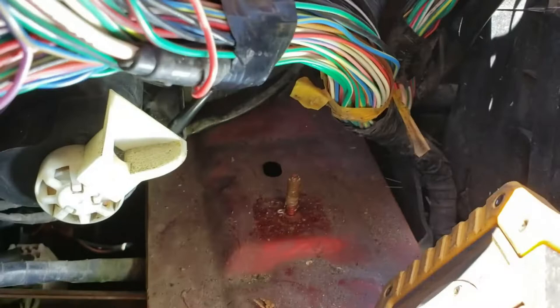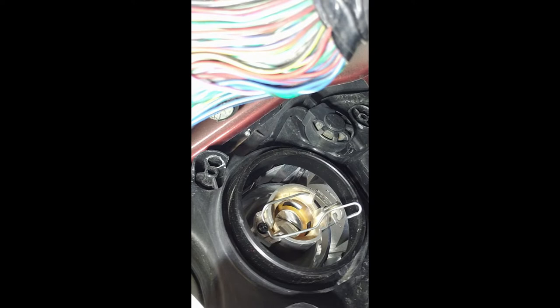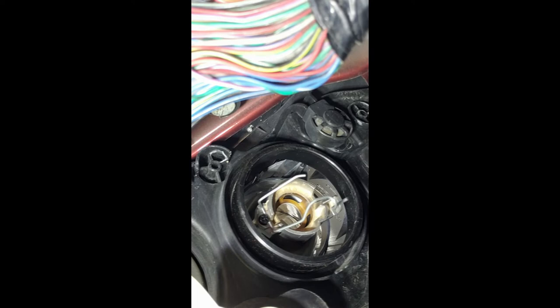Okay, so there is the spring clip. It hooks under a plastic tab. When you're taking the bulb out, you push the clip towards the front of the car and kind of tip it to the left and it unhooks and swings out of the way, allowing you to remove the bulb. Now you can see the bulb in place and that spring clip underneath the silver plastic tab — that's the part you release and the bulb just pops out. The bulb is oriented — it has on its base a black plastic tab which fits into the appropriate slot.